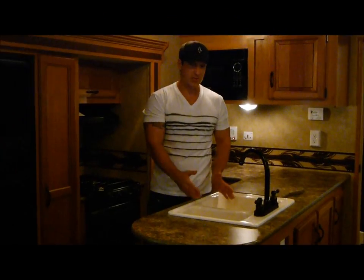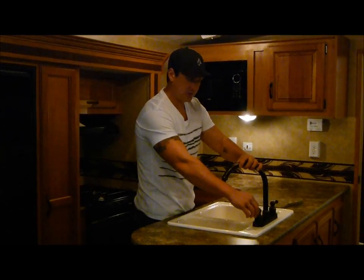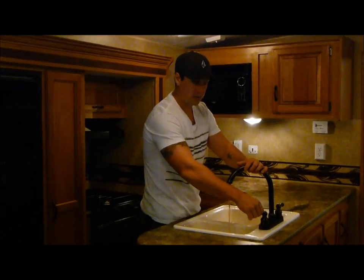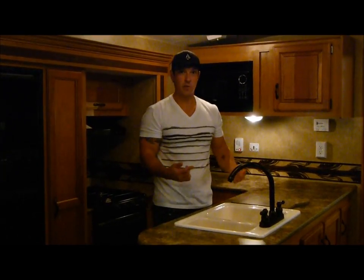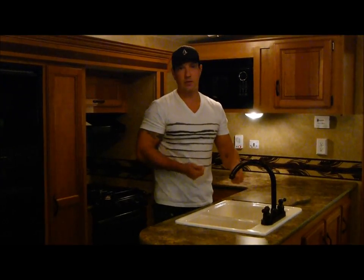Most kitchens will have a double sink, so if you do the hot water in one sink, make sure you move the tap to the other sink and do the cold water — that way antifreeze will be throughout all your P-traps. If you have leftover antifreeze, just shut your pump off, take your antifreeze jug, and dump some down the sinks just to make sure the P-trap is nice and full of antifreeze.